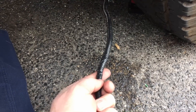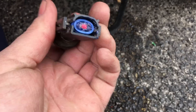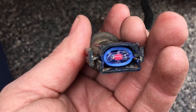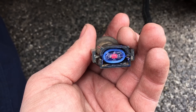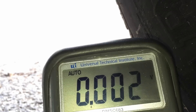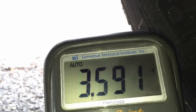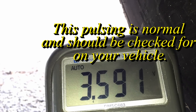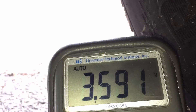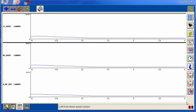I have the wiring fixed and I wrapped the whole harness coming out to the axle with electrical tape, including the spots with rubbing and chafing from mice damage and road debris — so it's all protected again. I cleaned the connector up, the weather pack seal is greased and slides all the way down and protects it, and of course a little dielectric grease on the connector with XG12 from Motorcraft. Now with the wiring fixed and the two terminals plugged into the DMM, we're getting pulsing 3.5 volts on the wire harness going back to the ABS module with key on — we definitely have continuity.